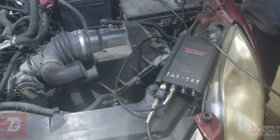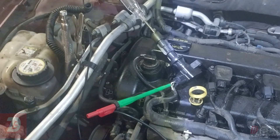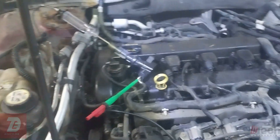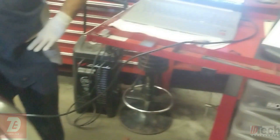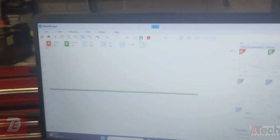We are set up with the scope to visually show you what's going on. We are using their Autel scope. We are going to tap into ignition coil one — we've got all the coils unplugged because we want it to crank over and rotate. We are going to capture the amperage draw from the starter with an amp clamp to get relative compression, and sync that with the ignition signal to see when the spark is firing in relation to piston position. The scope is all set up, and we'll go ahead and crank it.